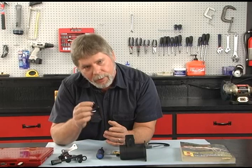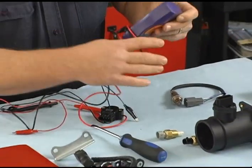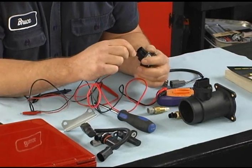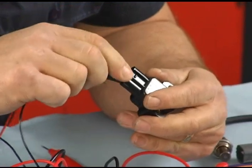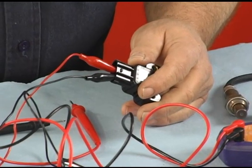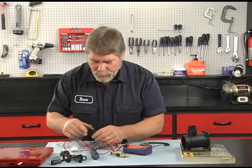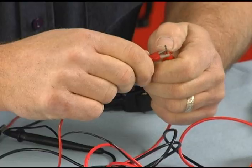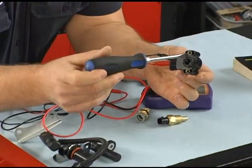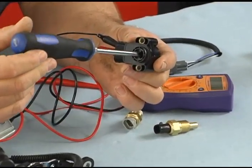This is really easy to check off of the car. Basically all we need is a digital volt ohm meter, and we're going to use the ohm circuit to check the resistance of the sensor itself. This is a three-wire sensor — it's going to have voltage, ground, and then the signal return from the sensor. I've got the two leads hooked up and connected to our DVOM, set on the ohm scale. I want to take the screwdriver, put it in where the shaft goes, and watch my DVOM as I turn the TP sensor.